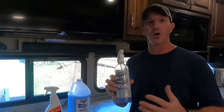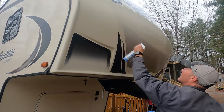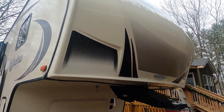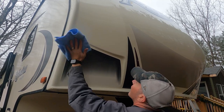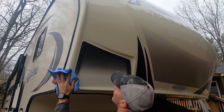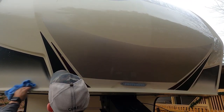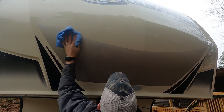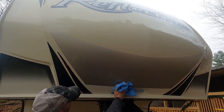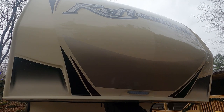If you've got a lot of really heavy dirt, road tar or something like that on the front of your RV or down by the wheel wells, it's not going to take that off. But what this stuff will do is remove the dirt and leave a nice slick finish when you get done. You don't need any water — you can use it waterless or you can use it with water. What I did on the front of our RV after I used the black streak remover: I rinsed it down really good, then sprayed this on the front as I dried off the water, and it'll leave it nice and shiny with a nice slick finish.